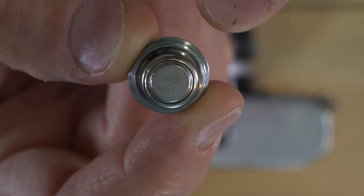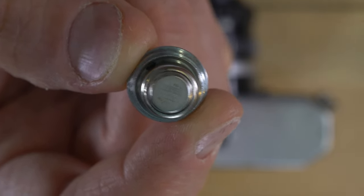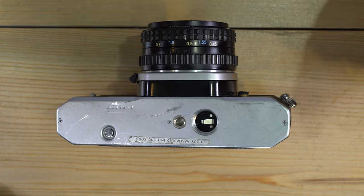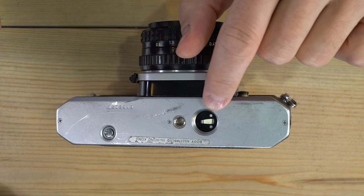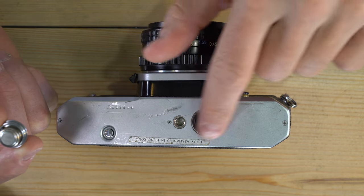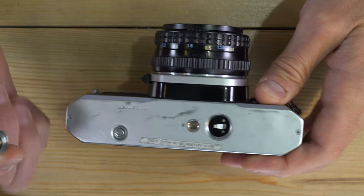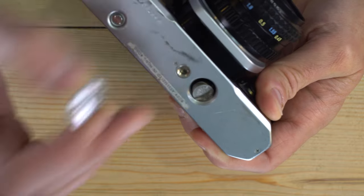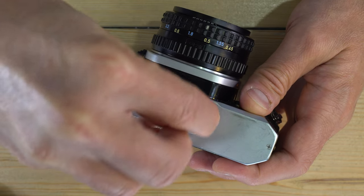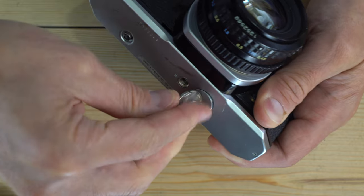A leaked or exploded battery is repairable, but sending it off for professional repair costs more than decades' worth of good batteries. Just buy a good established brand name battery and you won't regret it. Back at the battery chamber — there's a contact in there, and the outside of the camera housing completes the circuit that allows the light meter to work. Put the battery back in, then drop the battery cap on top and reverse-thread it a little to get the threads seated well.